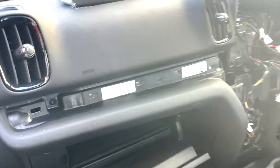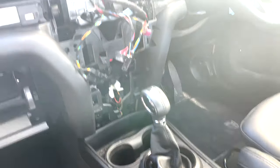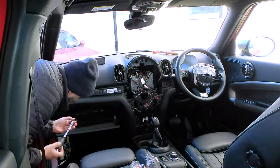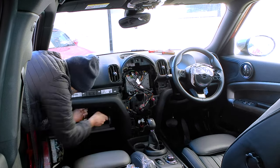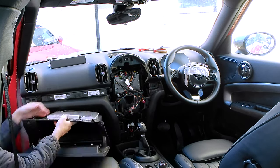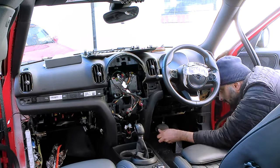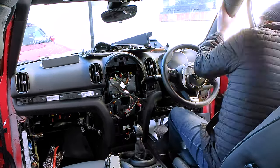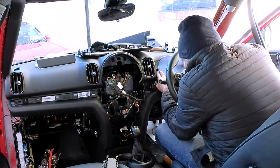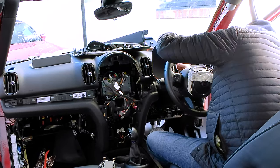So this is what I'm left with. I've removed the screen and that's the infotainment computer there which I'm going to pull out in a minute. I've revealed quite a few screws which I can now start taking out, but the next job is to remove the glove box. This is held in with a number of screws on the inside, top and bottom, and there's a trim under the dashboard which reveals yet more screws. Then I carried on removing all of the trim one by one including the A-pillar trim and the trim under the driver's side dashboard. Lastly for this section I removed the driver's display which just has two screws at the bottom hidden behind rubber grommets and then the unit just slides out.